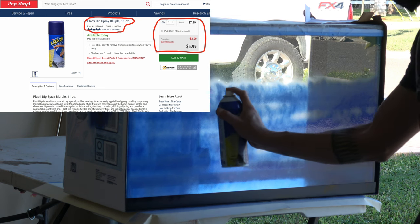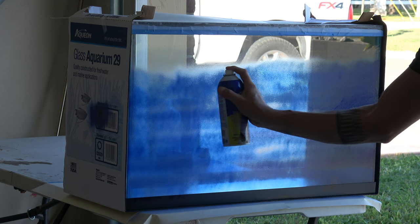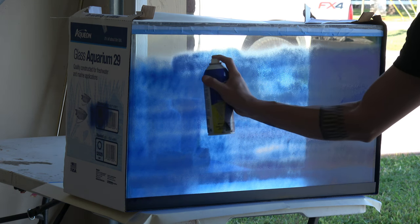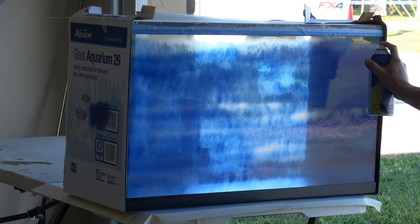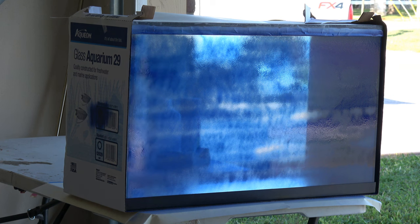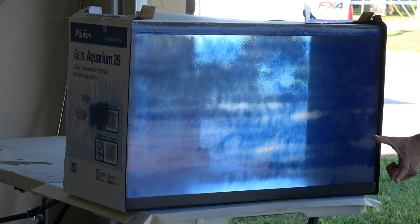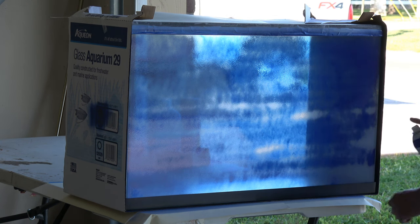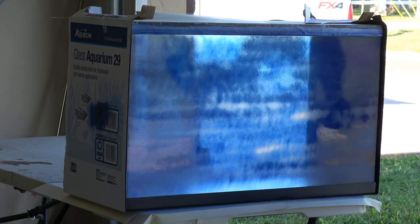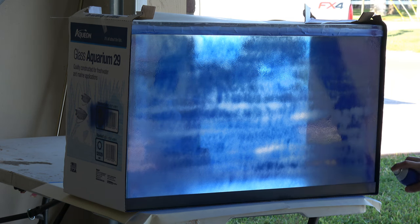Here I'm painting it — I'm about four to five inches from the nozzle to the glass. I know that's kind of close but it was a very windy day so I had to get up close. Some of you painters out there might be thinking it's going to look ugly — it's not. The reason is PlastiDip is kind of different. It's not like spraying paint with an air gun because it's basically like liquid plastic or liquid rubber. It goes on kind of weird but hang in — I'll show you what it looks like in the end. It looks really nice.